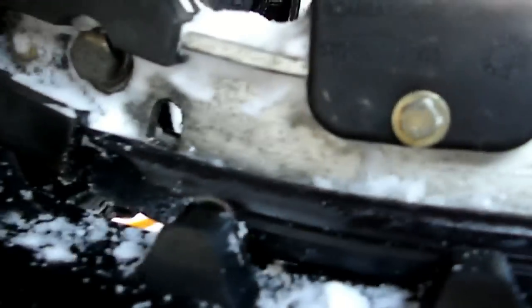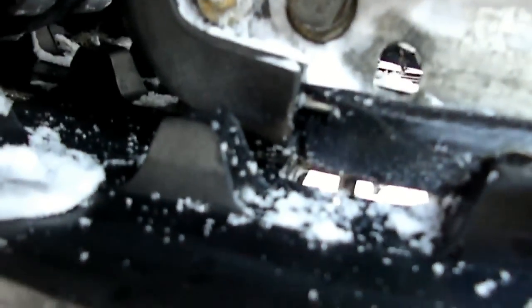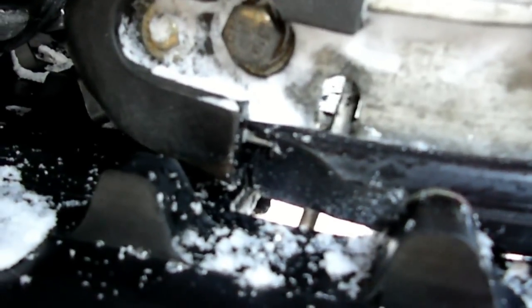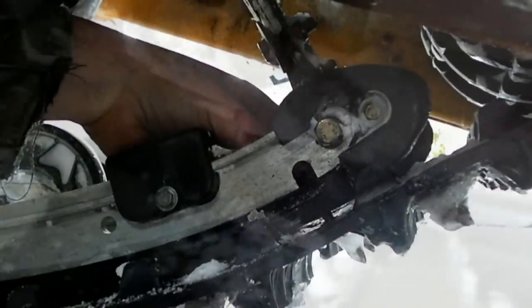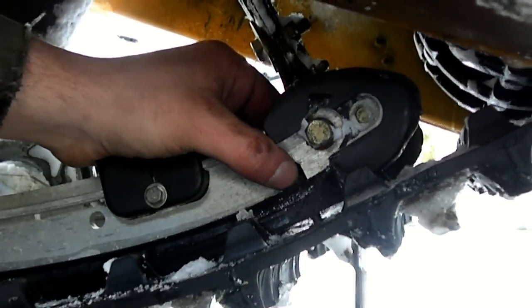To fine tune the position of your slider and line up with the bolt hole properly, take a small screwdriver and stick it up into the hole where the bolt goes. You can see the screwdriver head sticking through and move it back and forth a little bit — that'll help to position the slider where you need it to be. Then slip the nut in and turn.